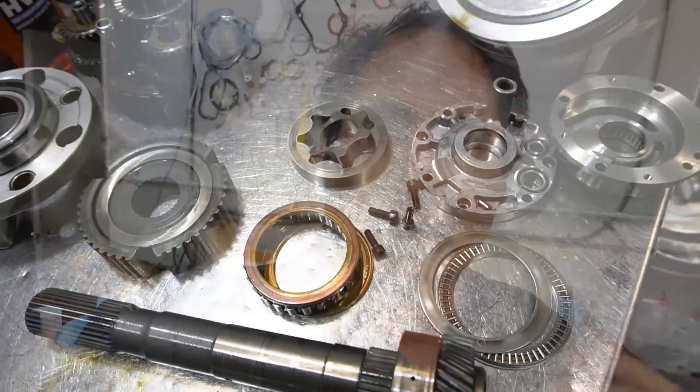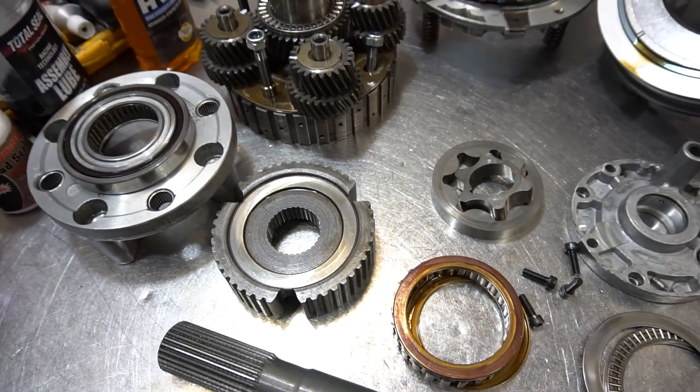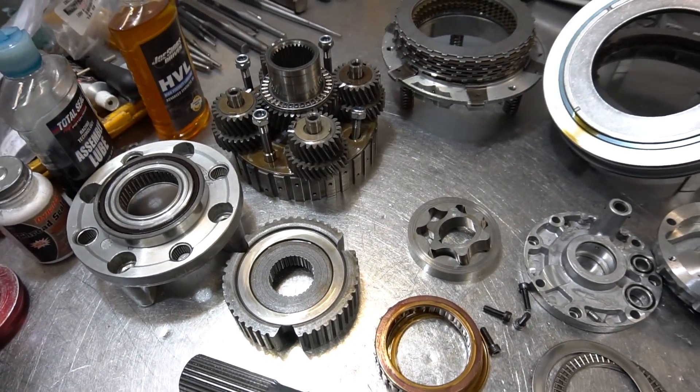By understanding how the system works, you'll get a better feel for diagnosing issues and why the system is working or not in certain conditions. For example, if you put in that finger piston wrong, it could be hanging up in two modes and smoke the unit — so that's very important. I'll go through all these details again when I assemble the transmission for you. I just wanted to give you a tip on the mechanics of it and how it works. In the next part, we're going to cover the electronics of the unit. Thanks for watching.